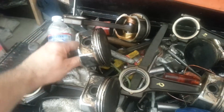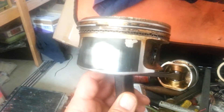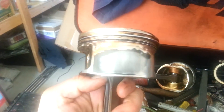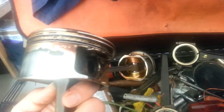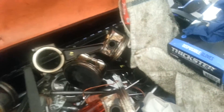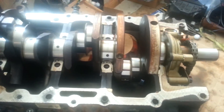I've already pulled cylinders out — pistons, connecting rod. All the bearings, everything looks really good. There's a little bit of wear on the skirt; you can see how it wore through that. Besides missing a little bit of the skirt coating, all the bearings look brand new still.